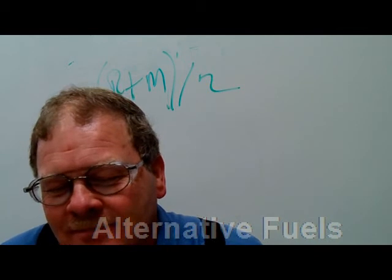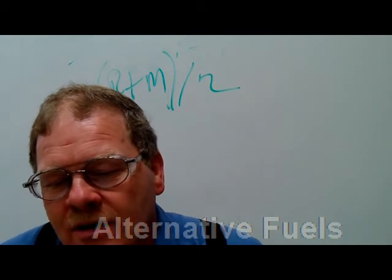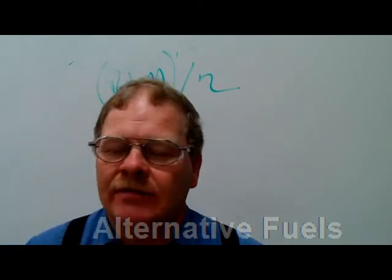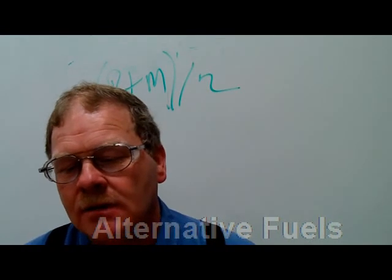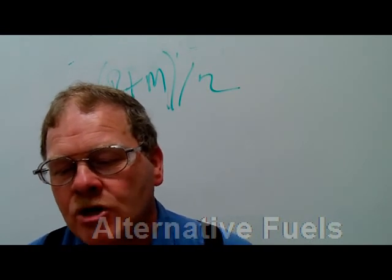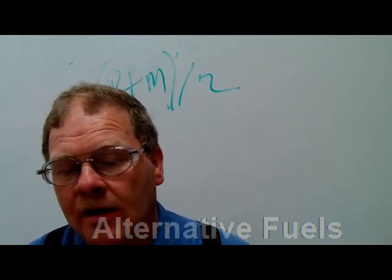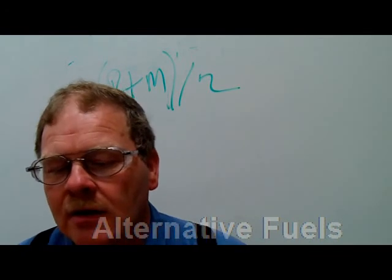Okay. Let me back up here. An engine designed to burn compressed natural gas may include what design modifications? That's a scratch, isn't it? Increased compression ratio. They're going to do that because it's going to give you a little more power, right? In other words, you're increasing the power by increasing the compression ratio, so you don't lose that 10%.